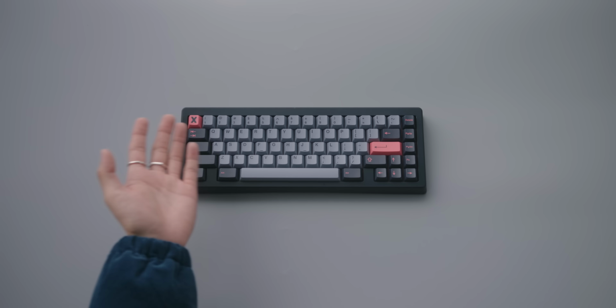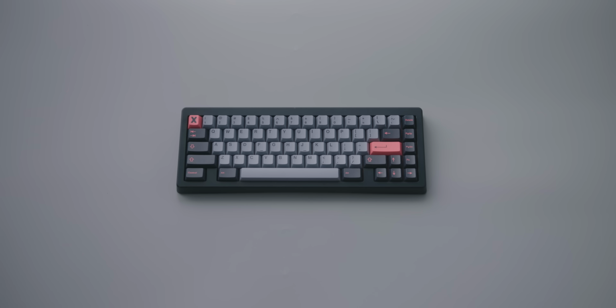Finally, we have keycaps, the final dressing to a keyboard. ABS and PBT are the two most common materials keycaps are made of. Now, there's this common misconception and almost brainwashing that's occurred, probably due to the gaming industry, that keyboard enthusiasts are tired of addressing. PBT keycaps aren't necessarily better than ABS. Not all PBT keycaps are equal, and likewise, neither are all ABS keycaps, and just because a keycap set is made of ABS doesn't make it automatically inferior to PBT keycaps.